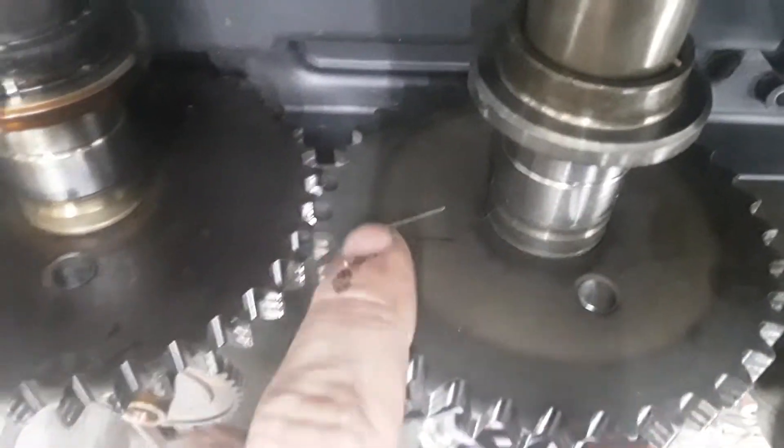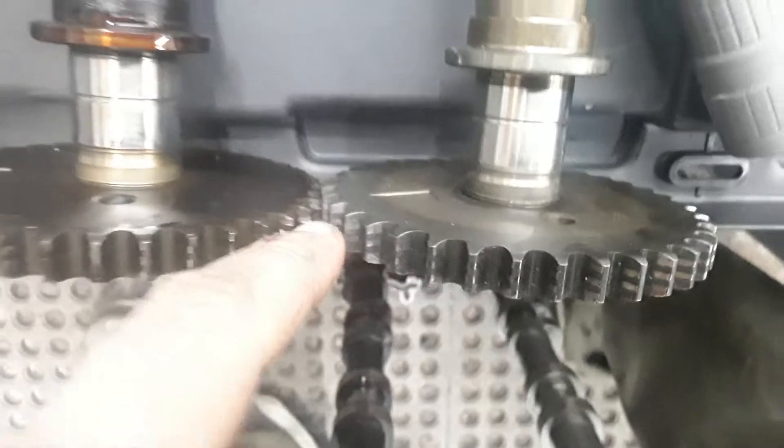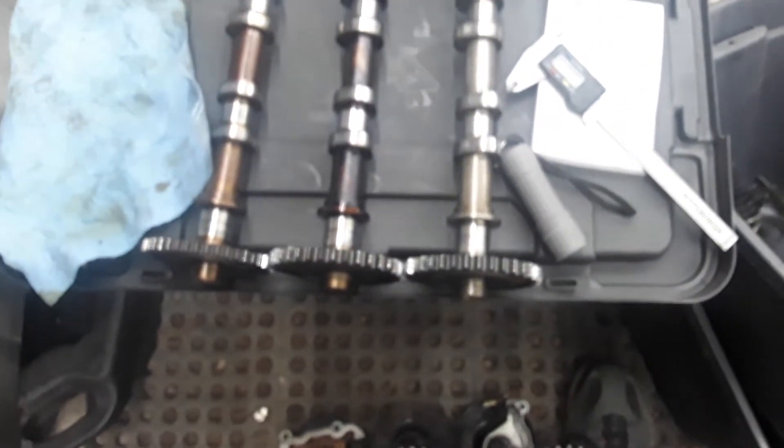Some cams have little teeth marks on one side, some have an arrow on the back side, and some have two little indentations on the back. You can see a variety here — that's the arrow one, this one has a couple of timing event marks, and then this one also has two event marks. How to time these is not something I want to dive into — it's complicated enough. The book Ford uses for the 96 Contour and Mystique says to go off these arrows, and they have to be pointed at each other, but not when you think they do. It's not user-friendly at all. Anyway, I want to get into the cam lobes before I run out of footage.